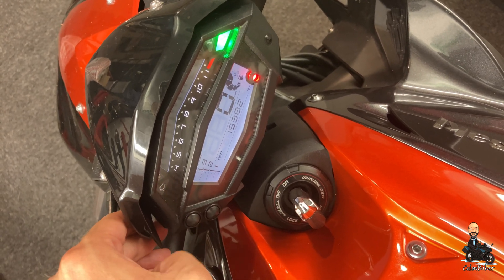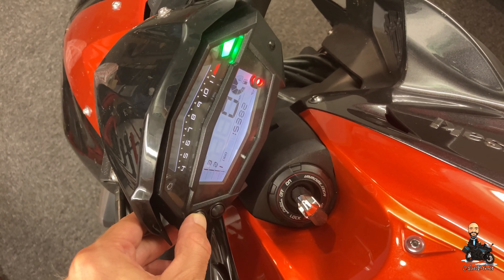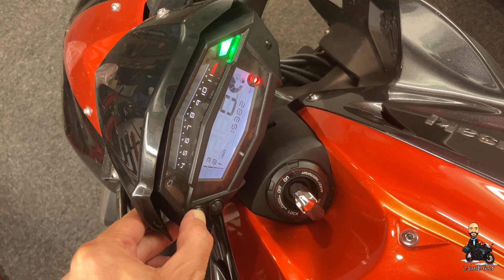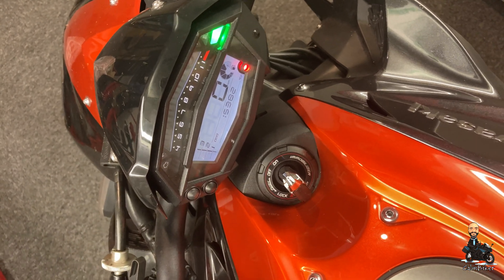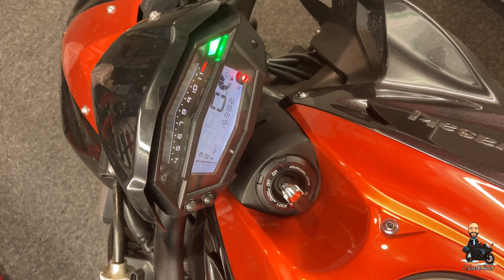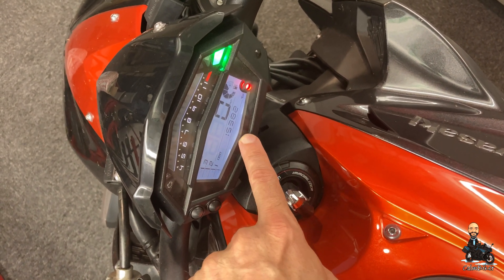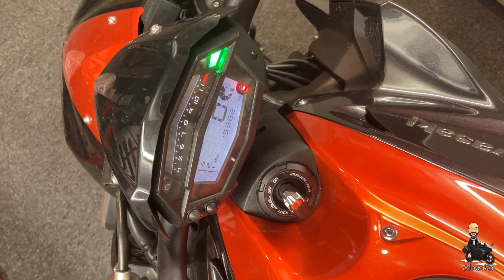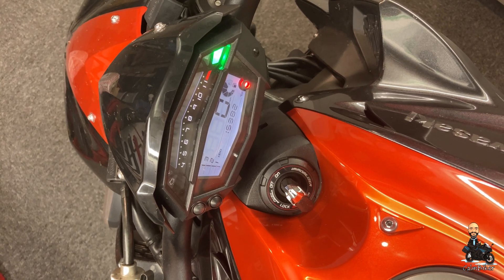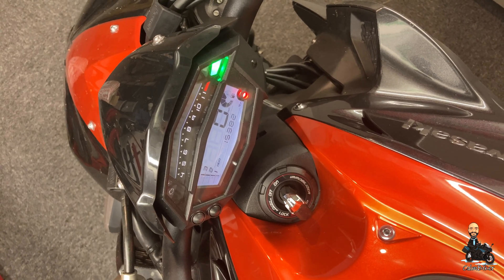Not got very many miles in this year with this blooming virus. Once you're on the odometer, press and hold the same button again and in theory — I say I've never seen it happen because I haven't got a problem — but in theory once you've held that down for a couple of seconds, it puts the bike into dealer mode, and in dealer mode if there are any faults it shows them on the screen. So you'll see a fault code appear. If there are more than one fault happening with your bike then it'll cycle through those fault codes and then you can refer back to the manual. So Nev, if that works for you and you haven't got the fault codes to hand, give me a shout and I'll give you the meaning of those fault codes.